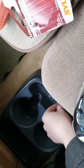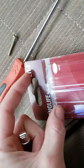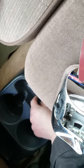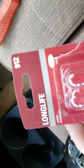I removed the light bulbs and I'll give you the model numbers. The little tube-shaped, fuse-looking one is model number 212 or 211-2 — they use these in most of the Ford trucks, Explorers, and some Mustangs. The map lights, also found in the Explorer, are model number 912. Pick those up at AutoZone, Advance Auto, or wherever you need to go.